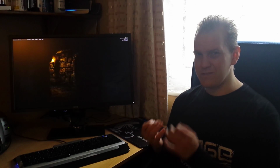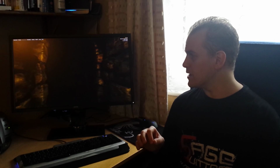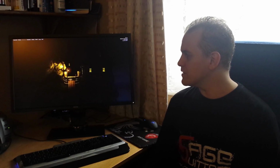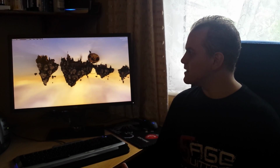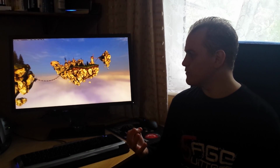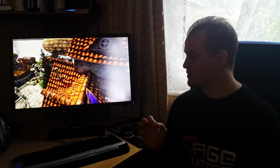It's rated for a 1 millisecond grey to grey response time, so all of the transitions are extremely fast and fluid. If you've seen my previous video reviews, we had a look at the Asus MG279Q. One of my complaints with it was the size of the monitor. A big real estate on that monitor, and because it only had a 4 millisecond grey to grey response time, which doesn't sound that much different, I always found that on a screen of that size, it was just too much to take in, and you couldn't really concentrate with a monitor of that size and that kind of response time. This really breaks the mould because the response time is just that fast.